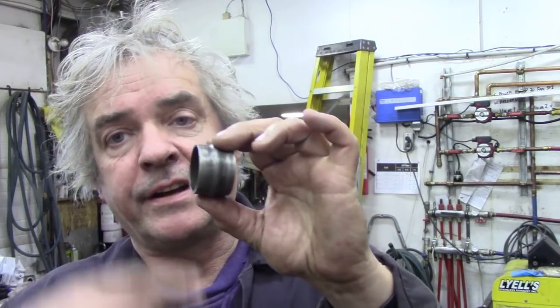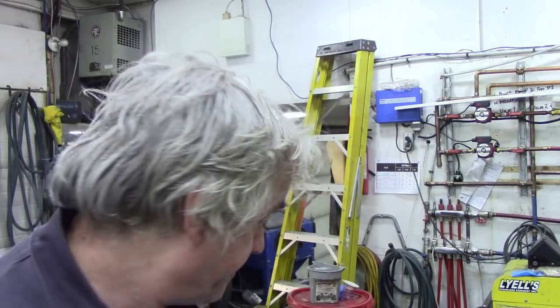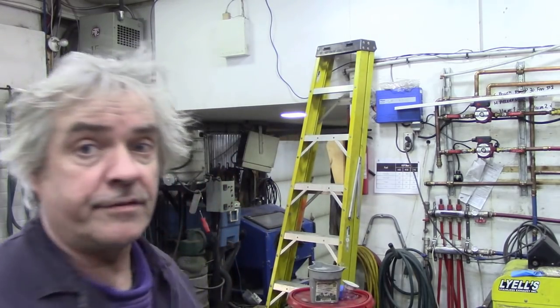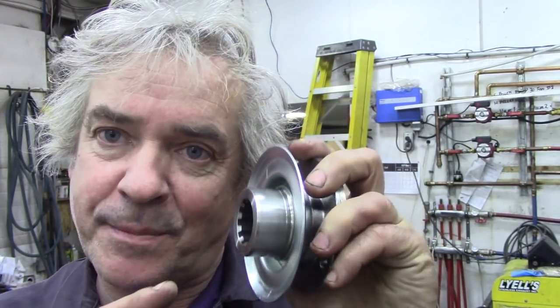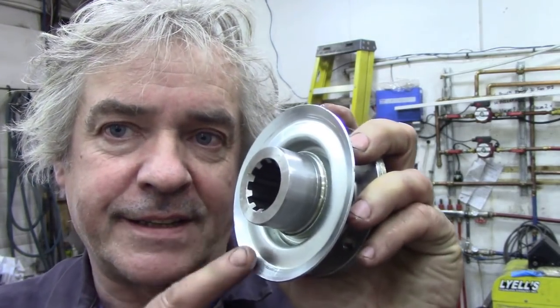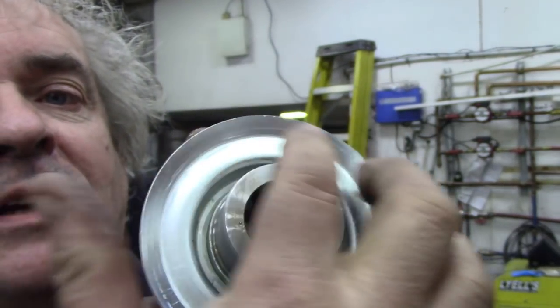Fine, that was great. They said once you've calculated the height for the carrier, then you could put this sleeve in and crush it down and assemble it with the oil seal and the flinger and the flange, and that's where my problem started. If you recall, I bought a new flange in a kit. Except what was happening was, when you were trying to set it up and set the preload on it, this was catching the nose of the differential. If you look very carefully, you can see when I was turning it, how it was putting a scratch around here. No big deal.